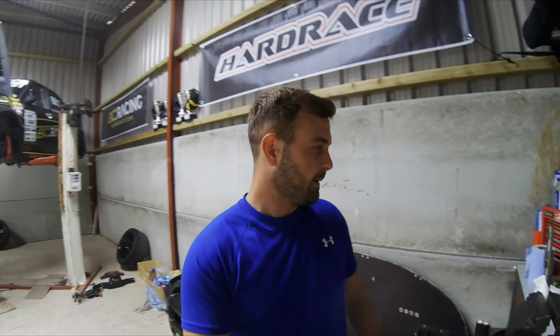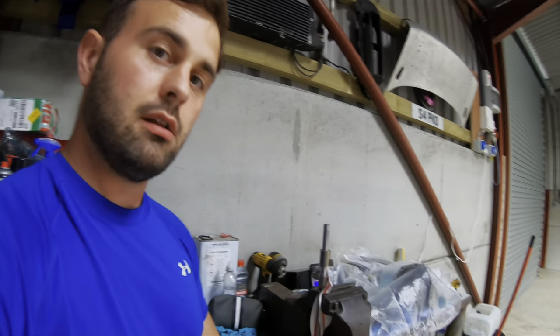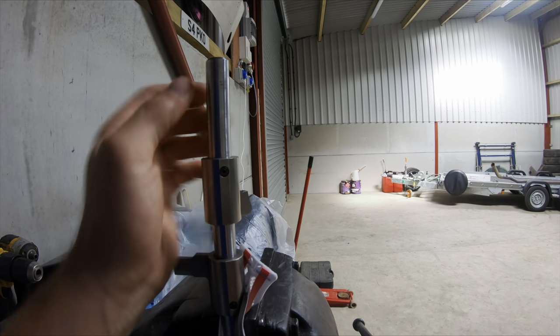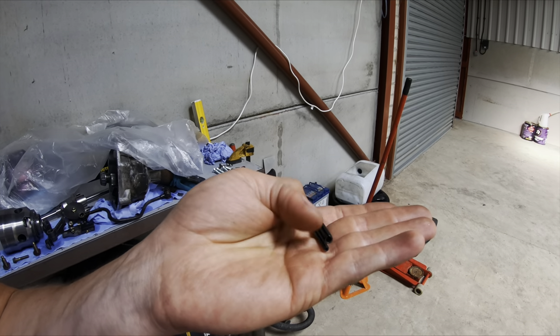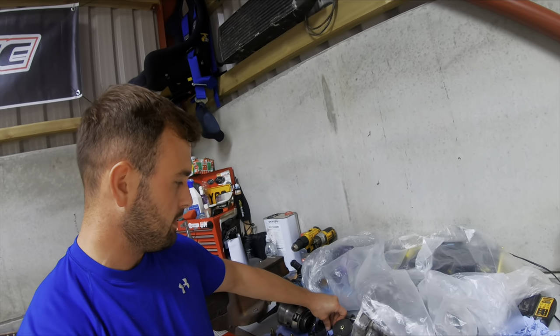I'm going to do a bit more of a detailed video of rebuilding it, putting the box back together. I'm doing this bit on the bench. Subaru have got these internal and external clips — like a little roll pin. I've got one here so you can see them. There's a larger roll pin and then an internal roll pin that goes inside the other one. They just punch out — you get a hammer punch and punch them out. There are a couple of areas where they appear on the gearbox.